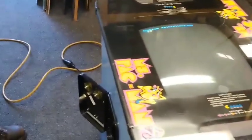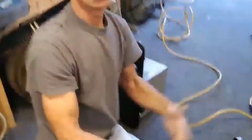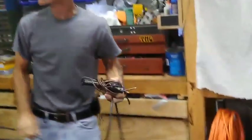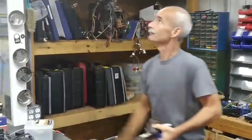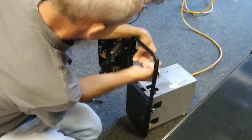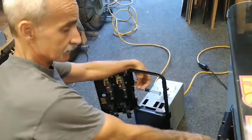I just didn't have the connection for the vent. They've been making these boards for years and they got them right — these ones are pretty solid. I got it on coin operator right now, 25 cents a play. This red button will give you credits. I can see it's giving you credits now — you can play on coin operator. So I could just tap into these wires and run them to the coin mech. That's where I had to see if I had to open this whole thing up and run a wire back to the board itself, or if I could just tap into the switch — and that's what we're going to do. We're going to tap right into here to get this thing done quick. This is where I do the wiring and assembly, where I build my own machines. If we just test out parts, that all happens in here too. We're just going to switch the whole door as an assembly, and then you'll have extra coin reject buttons and coin vessels which will come in handy.